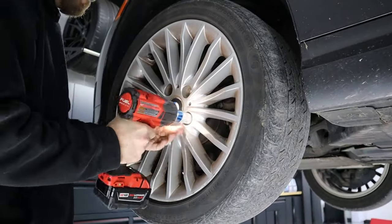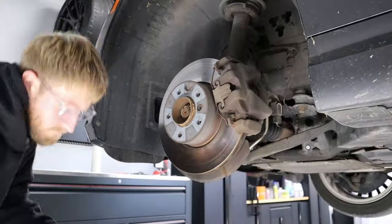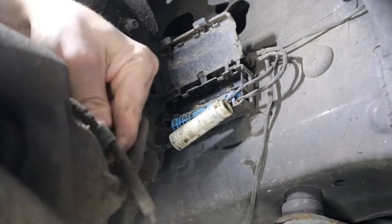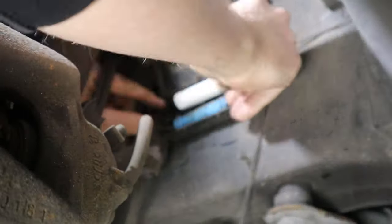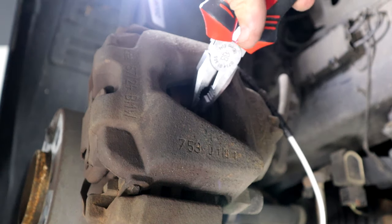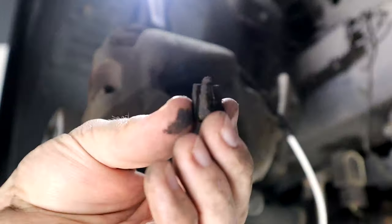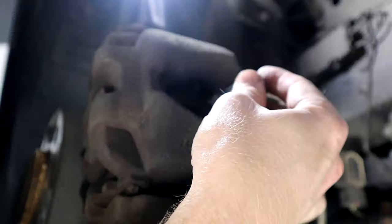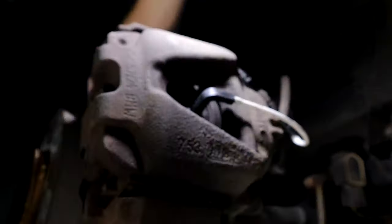While I had this thing up in the air, this car has been dealing with an annoying red warning brake light on the dash, and I figured there had to be something going on. Sure enough, a brake pad sensor completely torn apart. So I took what was left of this thing out of the car, unclipped it, tried to clean everything up, and then I went ahead and clipped on a new sensor, ran the wire, and pulled what was left of the brake pad out from the old sensor. I don't know what the previous owner did to tear this thing apart — no clue, super weird. But I inserted the new pad sensor, put the wheel back on, and the warning light went away.